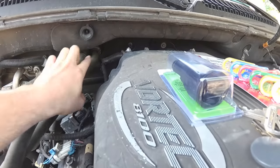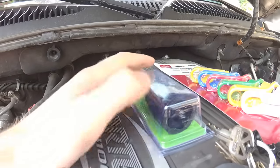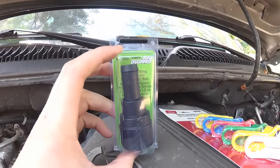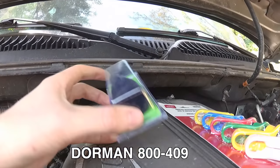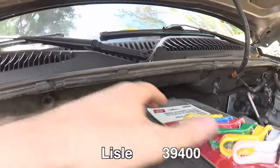We're doing a heater hose disconnect. This little connector can break a lot on these Chevys. The fix you need is one of these Dorman quick disconnects — this is part number 800-409 from Dorman, and it's supposed to work on 99 to 2008 Chevys.